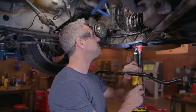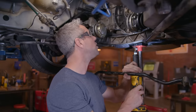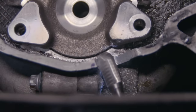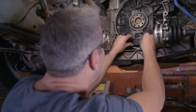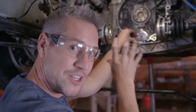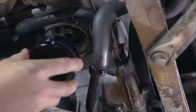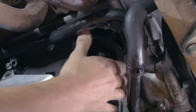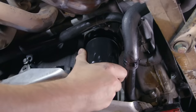I'm using this die grinder to slowly and carefully open up a space just big enough to accommodate that hole. It's better to remove small amounts and keep re-checking than go too far and remove too much. Just lining it up to make sure it fits — it's absolutely perfect. This adapter plate screws into where the filter was and gives a pick-up for which I can run a hose all the way to the back of the engine, and then of course a new filter.